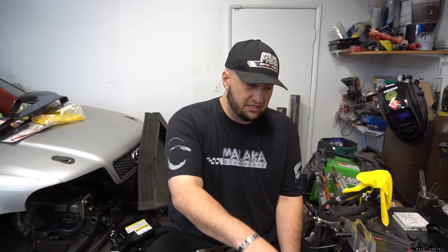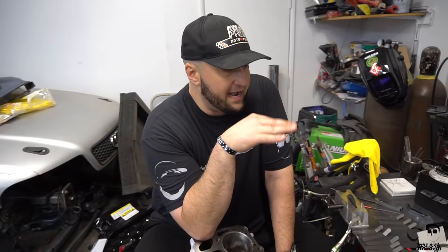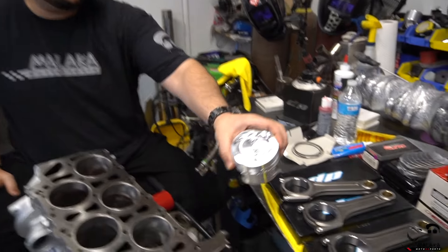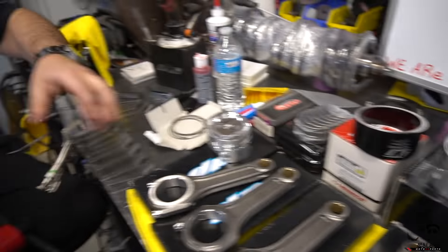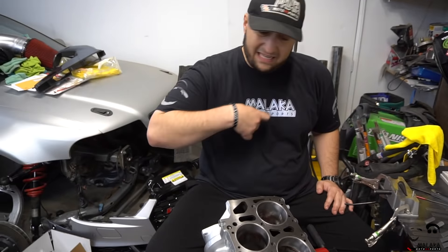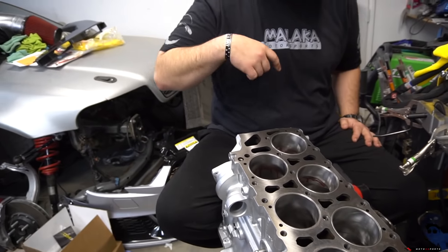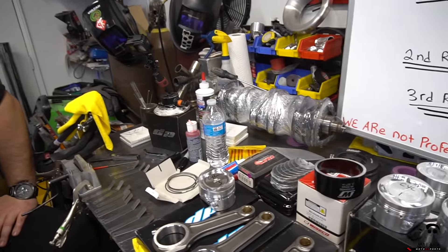As mentioned, this is not a how-to - we'll be posting Jay from Real Street's video as a guide for measuring and checking gaps on your race motor. Once I finish cylinder three I have three more to go, then I'll install the rings on the individually labeled pistons, assemble the rod to the piston, flip the motor over, clean everything - all the debris and particulates from filing get into the cylinder - spray it down, then install the crank and main bearings of course, and torque it.